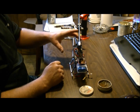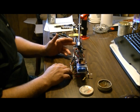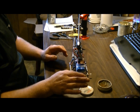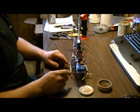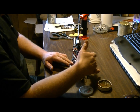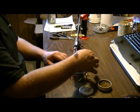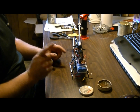At night I can control it too — I can turn on just the sides and the headlight, or just the tail boom. It's up to me because I've got a switch on either side. I'm only wiring one side today because I don't have my headlight in yet. The headlight and side lights are more involved — you've got four wires going into one connector and I'll have to splice in and hook my LED into the reds to power it. We'll cover that when the time comes.